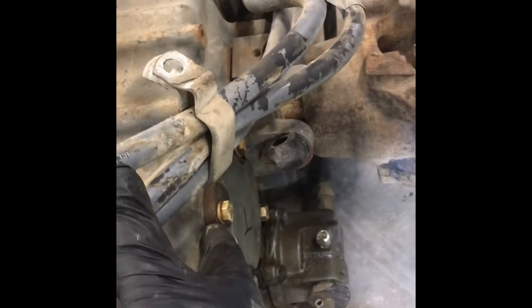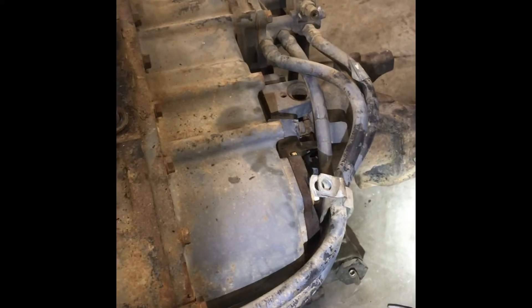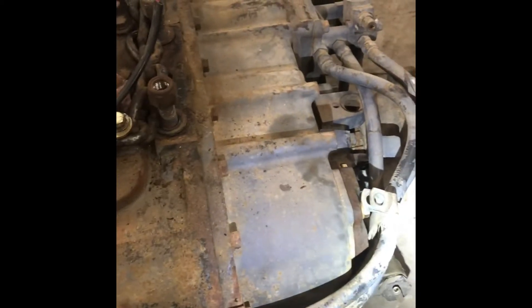This one's a little loose but it's not horrible. The clutch brake obviously needs to get replaced. He's also missing the shims out of his end caps on his auxiliary, and the gaskets. So I'm gonna go ahead and put the shims and gaskets in there - those hold the counter shafts in place. After I do that I'll show you guys how to put it back up in the truck.